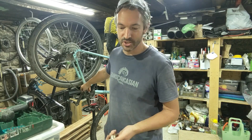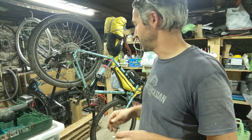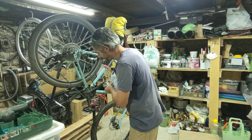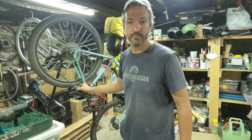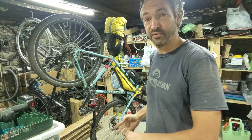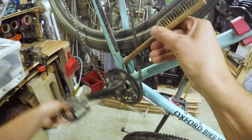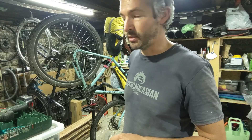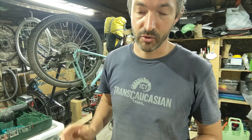Literally all I've done is slap an old secondhand spare 22 tooth chainring onto the crankset — no extra parts at all. Let's see how it shifts. So this is how it's going to be most of the time: 32 tooth. And then the idea is that I use my foot — basically do that — and there we go. In terms of getting the chain back onto the big chainring without a derailleur and without getting my hands covered in grease, Richard suggested getting a spoke, an old spoke, bending it over at the end and then using that as a hook.